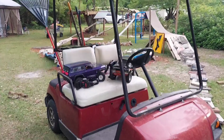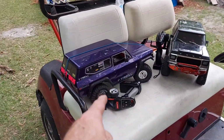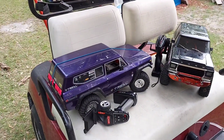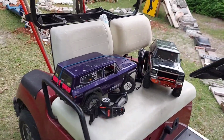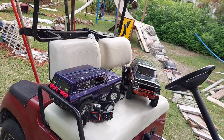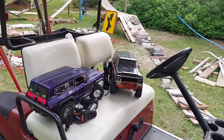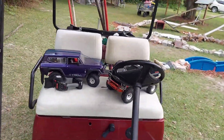Well, all right, guys. It's been quite a few days since I've actually did my modification on these mountain shocks here. I haven't even tried it since I've done it. So we're going to run it here in a little bit just to see if the torque twist is any better. And all I did was take the internal springs out of the driver's side where it always leaned, and stretched them a little bit. That's all I did, and put oil in them, topped them off. So I figure we'll go ahead and test them, see if that little improvement will keep it straight,